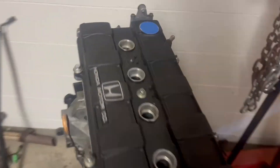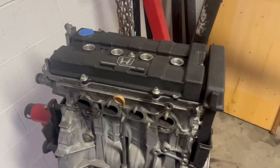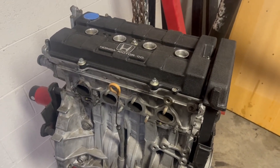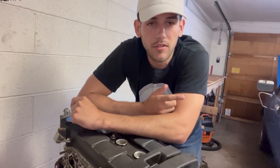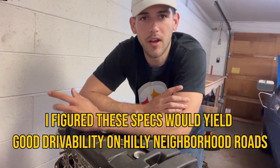An older four-cylinder might have an RPM range of between 0 and 8,000 RPM and an output torque of around 100 foot-pounds. Consider that you might want an electric motor with specs similar to these, but maybe with a lower top speed, unless you plan on redlining it all the time. Personally, I set a goal of around 3,000 RPM — considering that's normally where you drive your car — and an output torque of around 100 foot-pounds.